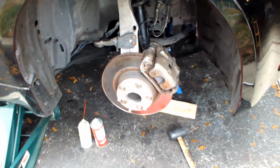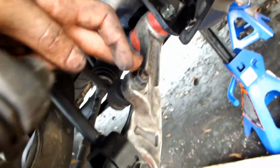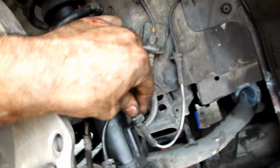Okay, so got all the bolts tightened up. So we got everything installed. Make sure that this disc and this bottom piece here aligns when you're mounting everything. Make sure you don't forget to tighten this bolt, the one in the back and the one here, and also this little guy right here for the little brake line, and connect these two hoses up for the sensor. And that's pretty much it. As soon as they're tight to spec, you're good.